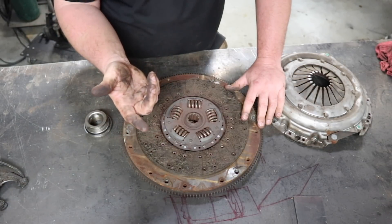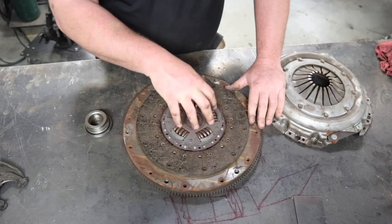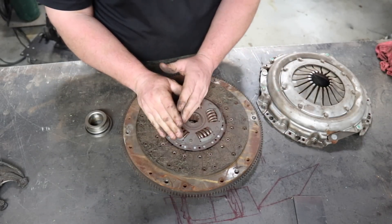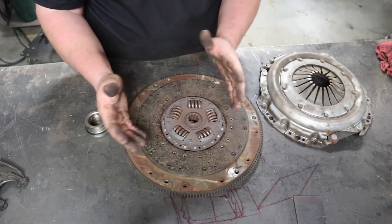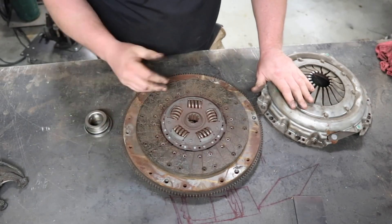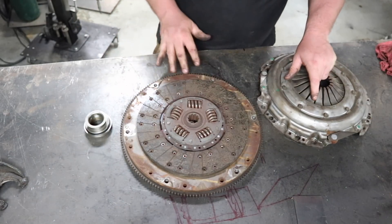On a four-cylinder it's going to fire twice every time the crankshaft spins, because it has to spin twice for all that to work, being a four-stroke. These little springs take up a lot of the energy when you're letting your clutch out. If you were to take your foot off the clutch and you didn't have these springs, you would feel a boom-boom-boom and the car would shake every single time the piston fired. This makes drivability of letting the clutch out that much better — that's what the springs are for.